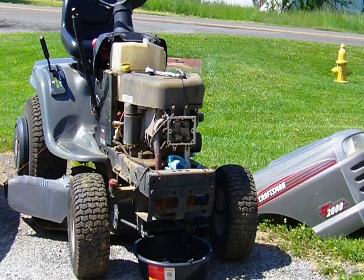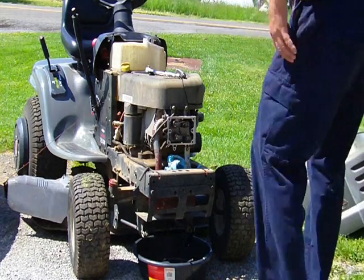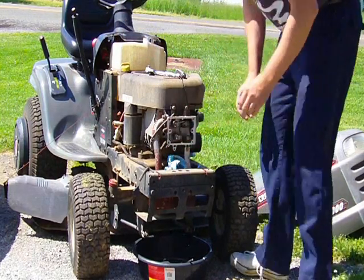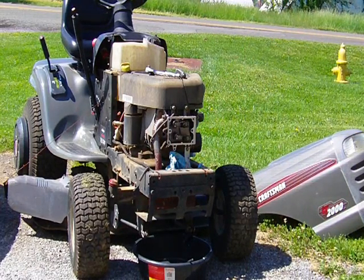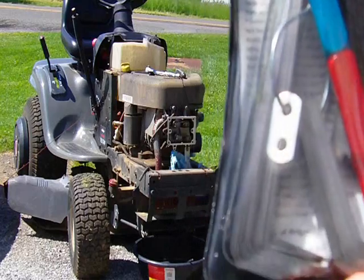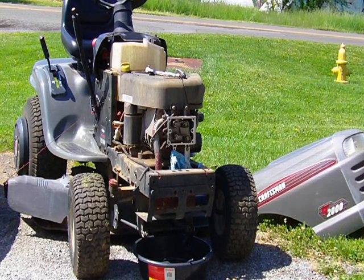What I just did is I've got both valves closed on the compression stroke, and I used a screwdriver down the spark plug hole to make sure the piston is at top dead center. I've got my deluxe feeler gauges here. The spec on it is between 5 and 7 thousandths on both valves, and it looks pretty good to me considering it's never been touched since it left the factory.